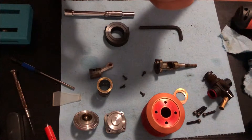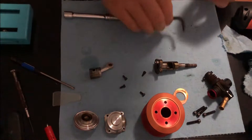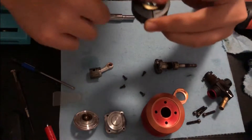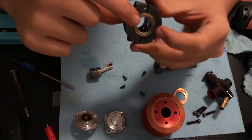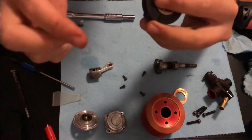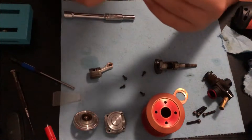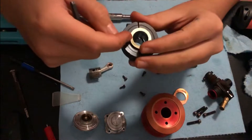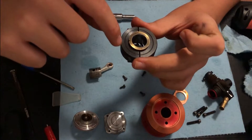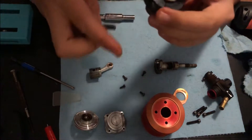If I need just a little bit more clamp, I use extra leverage. I'm going to put the copper tubing on the sleeve first. This clamp is the perfect size where the sleeve won't fall through, but make sure the top lip of the sleeve isn't inside the clamp, because then your head button won't fit if you clamp that part. Tighten it down just a little bit. The notch on the sleeve used to align it in the crankcase — I put that at the top, and each time I'll untighten it, rotate it 90 degrees, and line it back up, to ensure the most even pinch.